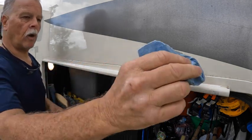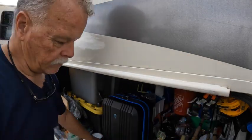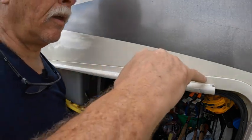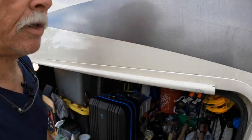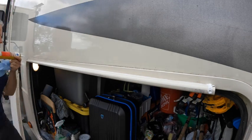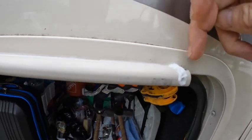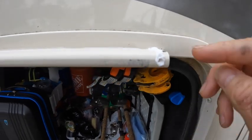I'm going to wipe off any excess. A little tiny bit over here that I kind of missed. Now I want to create a bead here - that's it. I'm going to do the same thing on this side. All I created is just like a wall. I'm creating a wall so if water was to come down and slide there - because I believe it's coming right through this corner, getting into the door and sliding down this way - I'm forcing the water to come onto the wall.